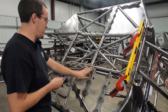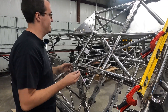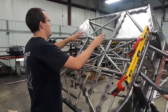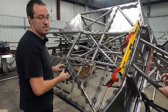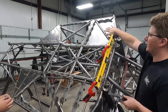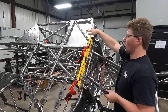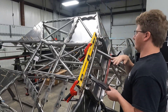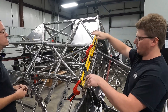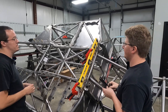We opted for a little bit thicker just so it seals up better and isn't floppy. The scallop strips, once you weld them they stay pretty flat, but if you run your hand across them you can feel them waving. That way it's not just a really floppy piece of tin. But that spec is for this side of the chassis — the other side just needs to be as light as possible to seal the hole. I went ahead and did carbon on the back piece since the .090 plate is there anyway, so it's as light as possible, and it makes the whole underside of the car flat — that's the only reason the panel is there, just to keep the underside completely flat for aerodynamics.